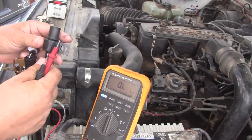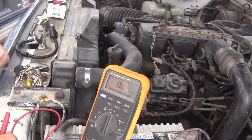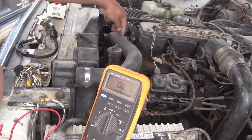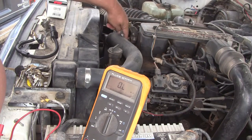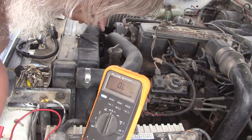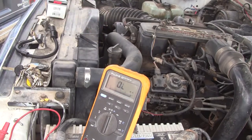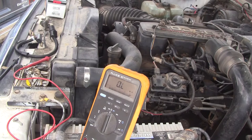To verify it before I purchased the new part, I measured it in the store and it was fine. The next step is to get under there. There's a bolt up here — probably 10 millimeter — that holds the connector, and there are two more bolts down below, probably 12, 13, or 14 millimeter. They're a real bear to reach. We established in a previous video that the alternator doesn't work, so let's get to it.